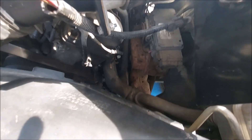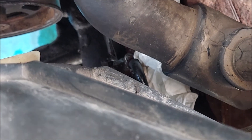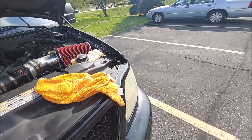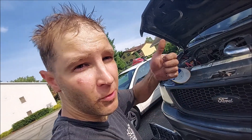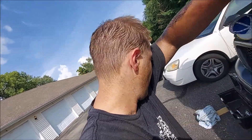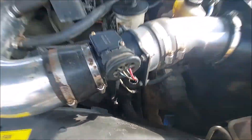Having to go turn by turn. That connector right there — it's out of the thing right now. I got a 16 and you just turn it. It was stuck in there. I could freely turn it but I was pulling on that line to get it out, and I really had to yank on it to pull that line out of the box. So once you get all that threaded, make sure you give it a good yank. Look at it before — make sure the O-ring or nothing didn't get stuck in that steering column. That's probably going to be the hardest part, is getting that line off. I did that first.